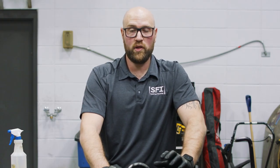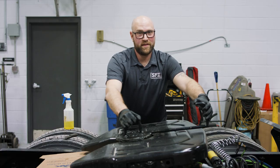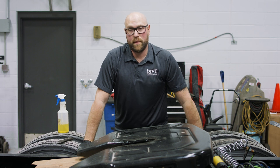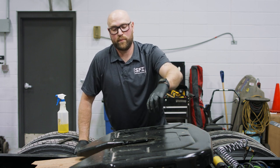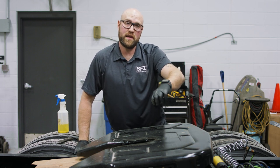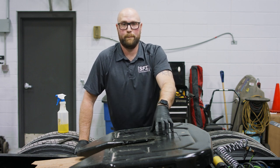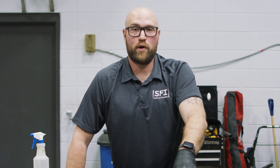Next, we're going to simulate pulling away from the trailer, so I'm going to take my test pin out. Now we can check and make sure the jaws are lubricated properly, and we can always repeat this process if we feel like we haven't gotten all the grease out yet. The fifth wheel needs to be cleaned and lubricated often to ensure proper operation.